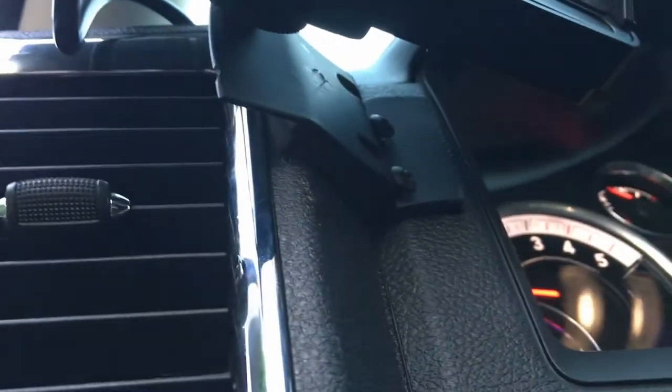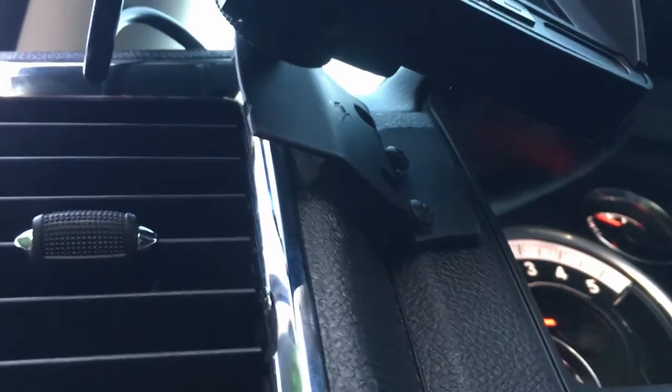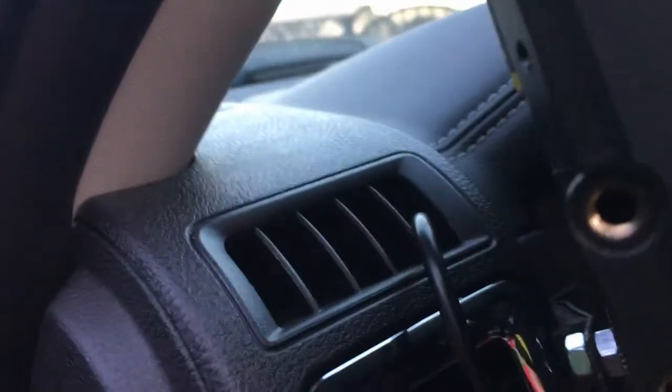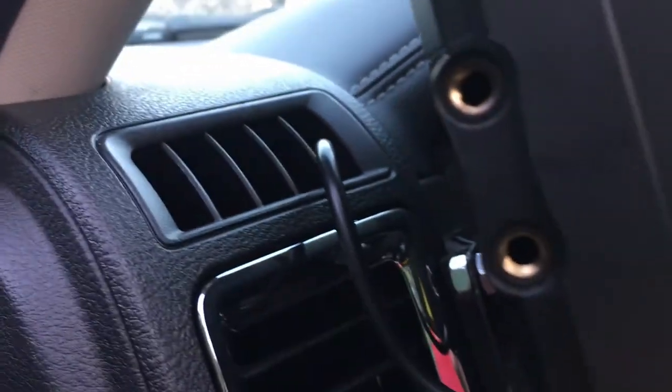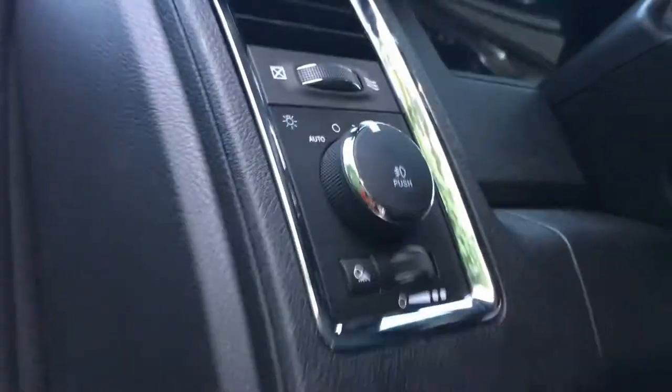Here's the actual bracket. It is basically just a v-shaped bracket. I put some sponge tape underneath it and ran those screws right through the hole, right through this kind of crease in the dash. So if I ever have to take it out, there's just two small holes there. I ran the cord up through the defroster vent — so no holes there — and you can't see it when you're driving. I hooked it up to my aux switches, and you can get underneath by just pulling this out.